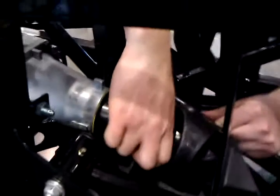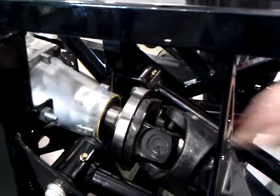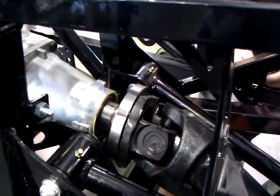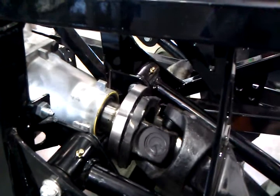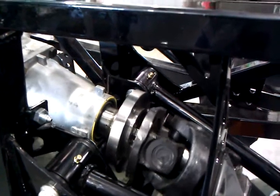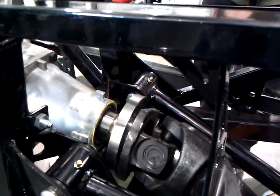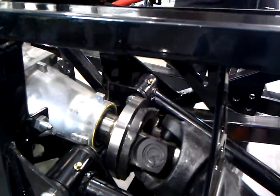There are only four holes on this drive shaft plate, so I'm getting those four holes lined up. Then we'll need the red Loctite. From the bottom here, I'm holding up the drive shaft while the builder trainer is putting red Loctite on the bolts.